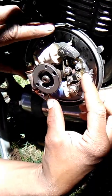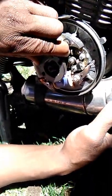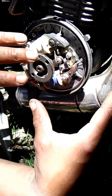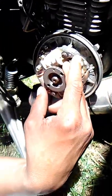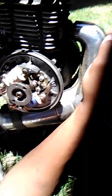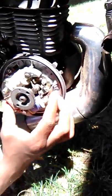For those that don't know — when it spins, this thing is spring loaded and it makes and breaks the primary circuit to build up the coil. So in other words, when these two objects touch together, it builds up spark, then the spark shoots out. There's no computer on here telling it what to do, so this controls what happens.